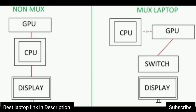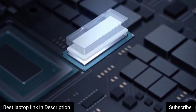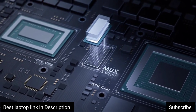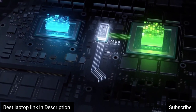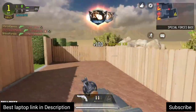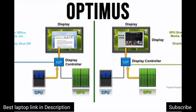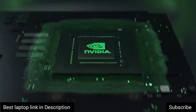The first type of laptop is integrated GPU connected to its display, also known as NVIDIA Optimus. This technique runs on a low configuration, giving you better battery life and it does not overheat. The problem is while using the laptop for gameplay or video editing, the GPU begins to render frames but has to go through an integrated graphics card before delivering to the display. Since the integrated GPU is mostly connected to the CPU, gaming sessions lag.